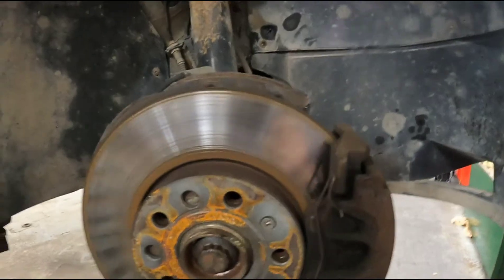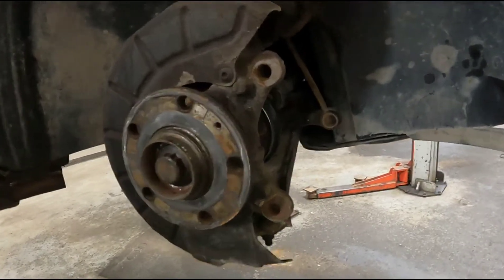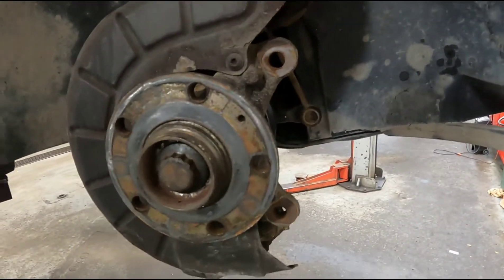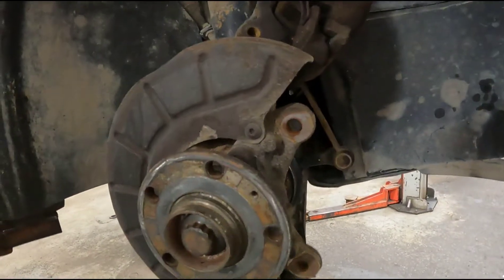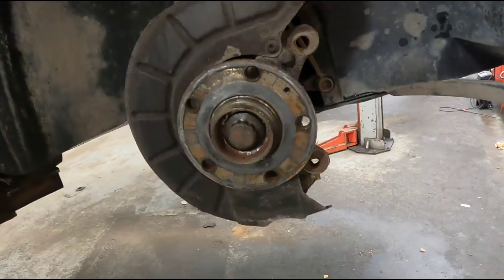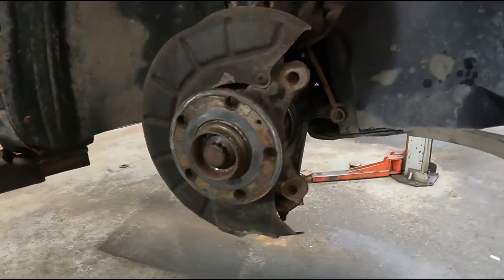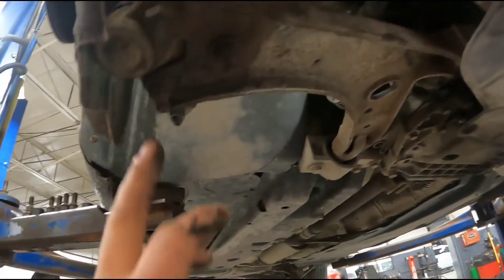Pull the set screw off the rotor and pull the rotor off the hub. Now with that stuff out of the way, you're going to want to loosen your axle bolt. I have an impact I'm going to use to take this bolt out. If you don't have an impact and you're doing this at home, before you disassemble anything — before you even take a wheel off the car — it's a good idea to pull the center cap out and just crack it loose a little bit, then lift it and pull it out the rest of the way. Sometimes those can be very tight and if you don't have a big pneumatic half inch impact, you should do it on the ground with a breaker bar. So I'm just going to take this bolt off.